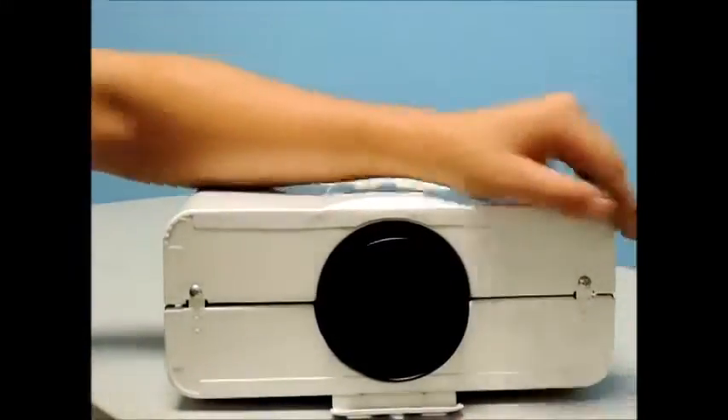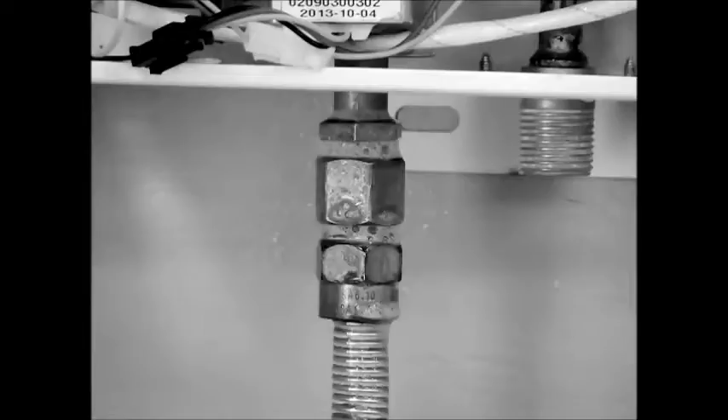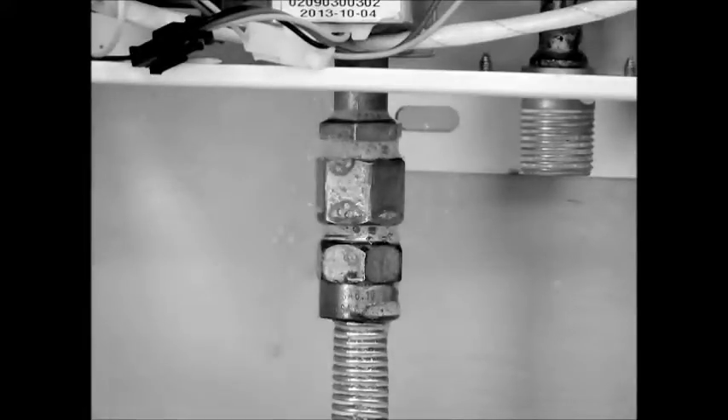You are ready to move forward. Please spray your gas connection with glass cleaner or soapy water. If you see bubbles, you have a leak and will want to loosen your connection and retighten. Please be sure to use a backup wrench when performing this connection. Next, reconnect the water supply lines and you are ready to activate your unit.